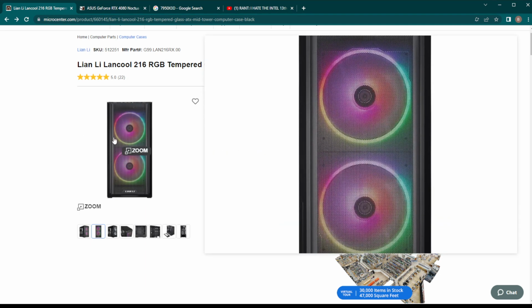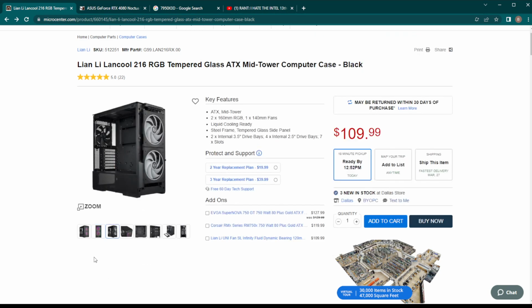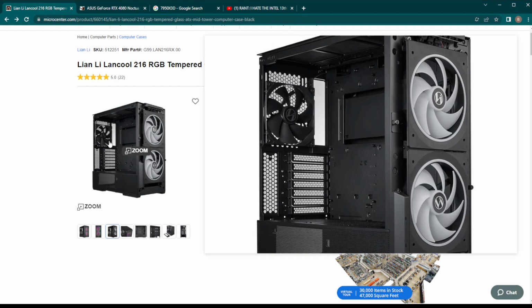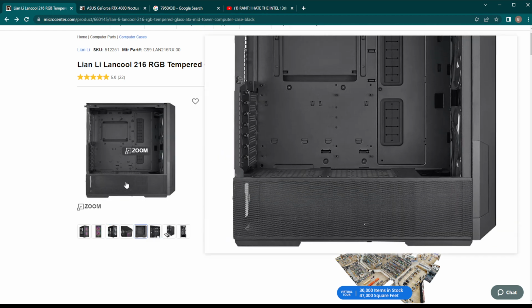And it doesn't have these crazy 160 millimeter fans, which I think are awesome for airflow. It does have some different water cooling support. You can get a 420 millimeter rad in it for the biggest AIOs on the market right now, but this case still fits a 360 millimeter on the top, and you can do that and continue to use these crazy fans, which is awesome. You can also put a couple of fans on the PSU shroud, as you see there, which will then pull air through the mesh on the side panel and cool down your graphics card.